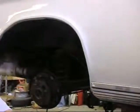Put the camera here on the spare tire, on the rear tire. Let's see what you're seeing here. Tap one side out and I'll take the other side out. Not the best thing when your wheel cylinders keep seizing every two or three years. Normally those pistons just slide right out. Sometimes they fall out while you're doing a brake job. They sell a special pair of pliers to hold them in. Can't believe those are spotlessly cleaned.